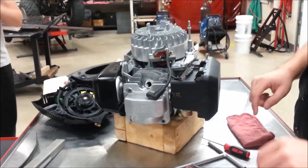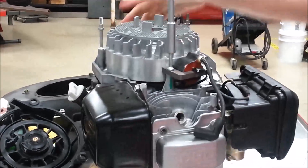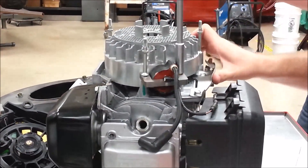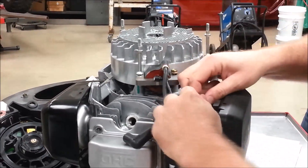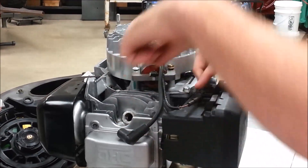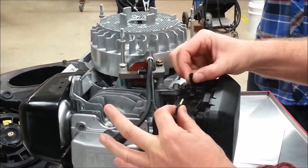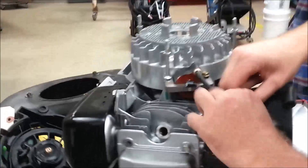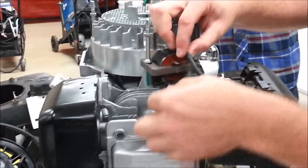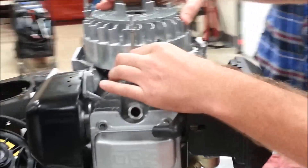The first thing I'm going to do is remove this ignition coil — we have two fasteners here. You guys look at this because you're doing the same exact engine. I want you to see something here: there's a wire, and you do not just rip the wires apart. Firmly support it on both sides and disassemble. This is also real common on Honda motorcycles — you can disconnect it this way.